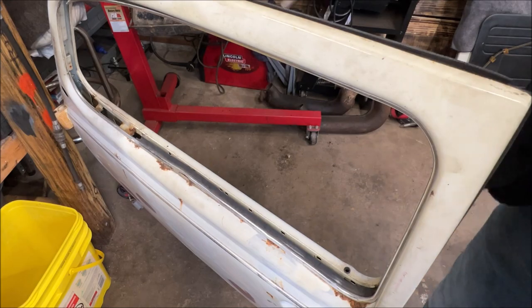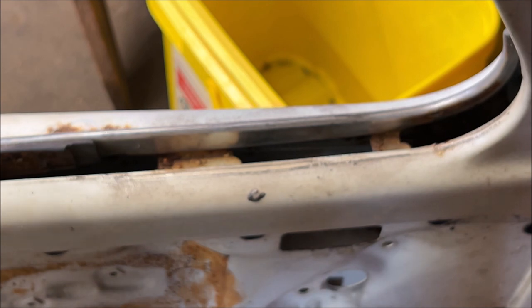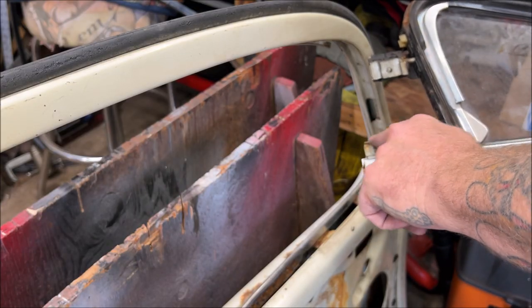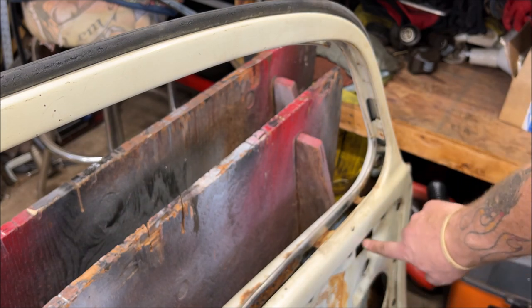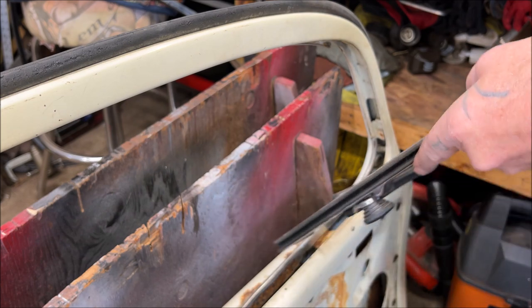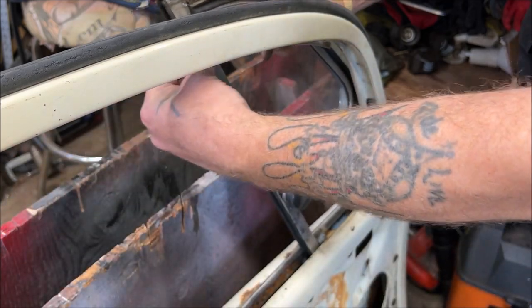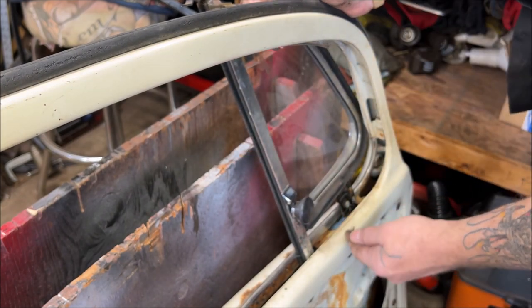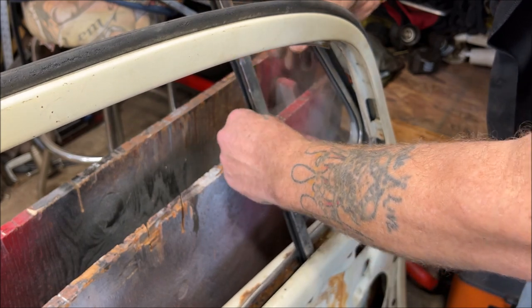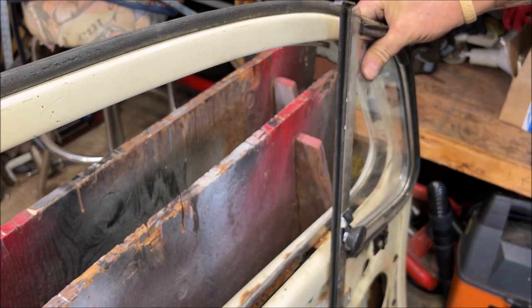Window and vent wing are out. When the vent wing is sliding out, it was hitting this lip. You need to pull towards the back of the car a little, and then it'll come out. Here is the tab on here — that's what goes down inside the door and bolts up. I hope that certainly made sense.